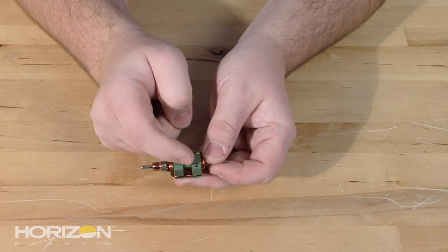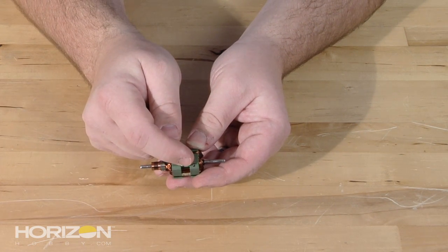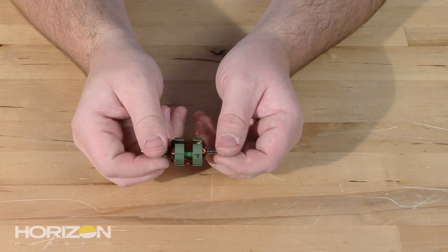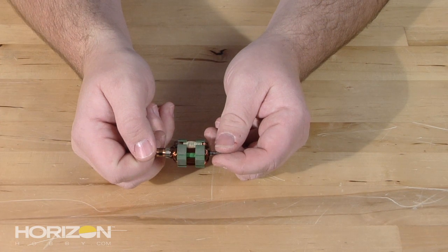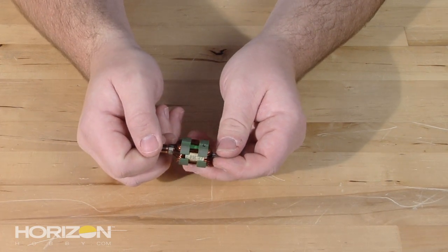You can also see on these stacks little holes that are drilled in by the manufacturer to balance the armature, to make sure that when it spins at high RPM you don't get a lot of wobble out of it — it just makes the armature spin more true.